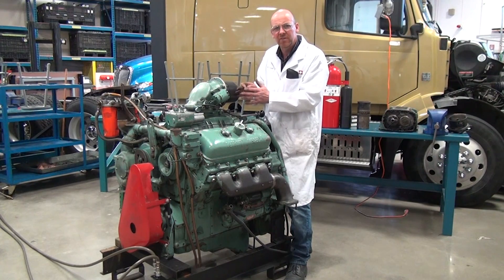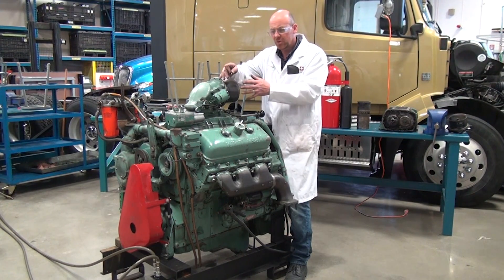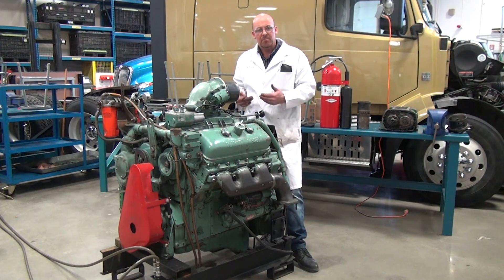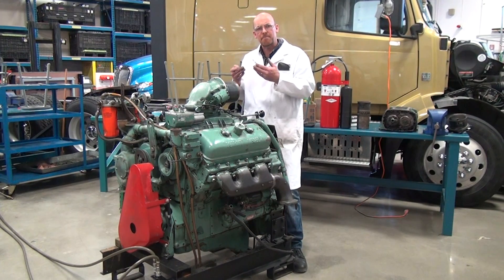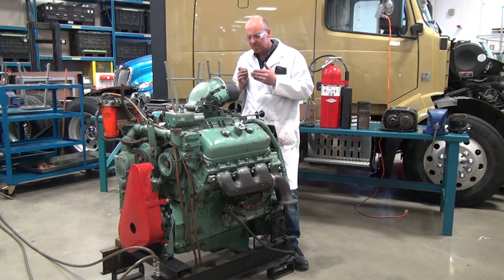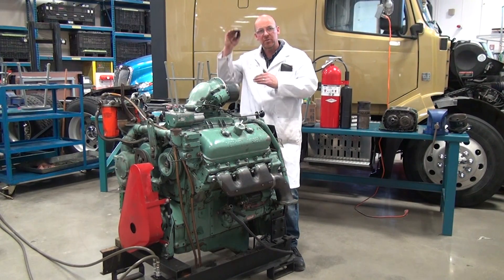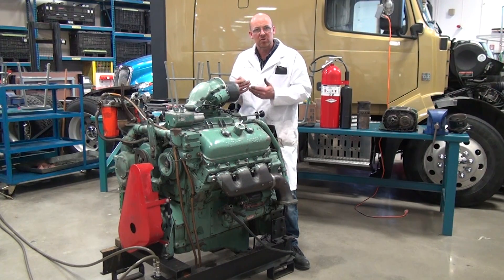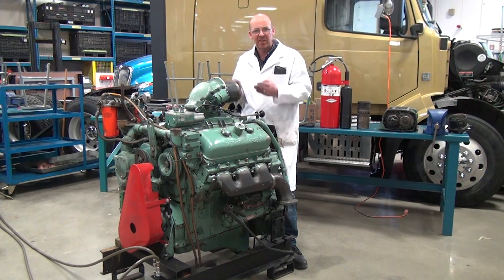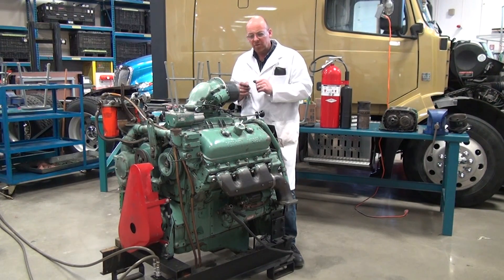It's a very dangerous thing and a lot of people don't know how to correctly shut these engines down. This particular engine has a couple of safeguards in place here at the college, along with manual controls that would typically be on the chassis. I have a CO2 fire extinguisher here and I'm going to show you how to properly shut an engine off using it — which allows the engine to be started back up after the repair is fixed. If you use a dry powder extinguisher, the engine could lock up instantaneously at high RPM and still cause internal damage. CO2 lets us correct the problem, start it right back up safely, without putting anything into the engine that requires a teardown.